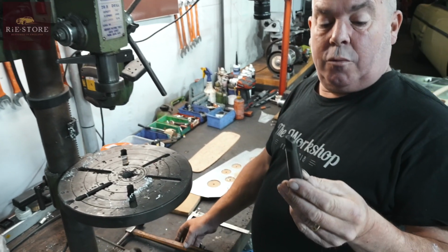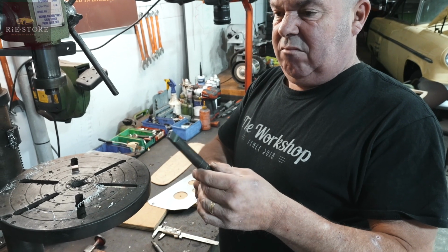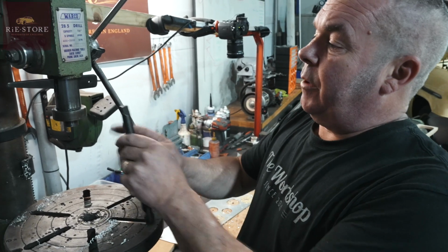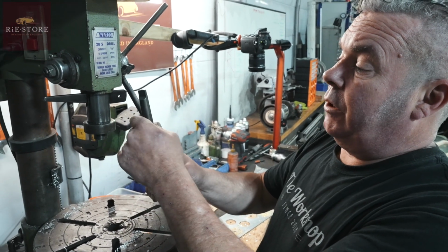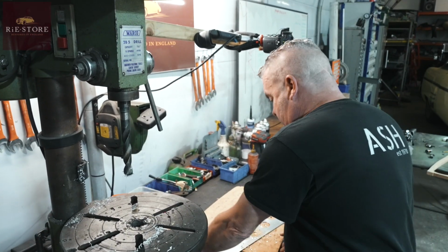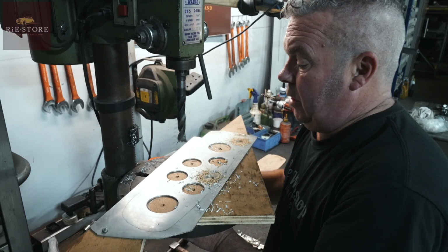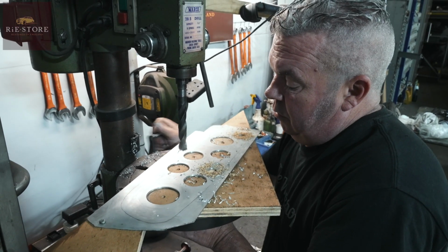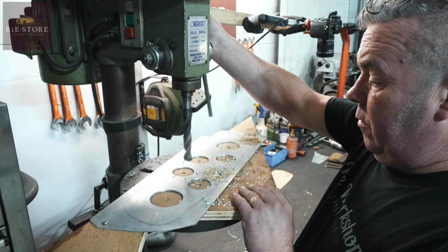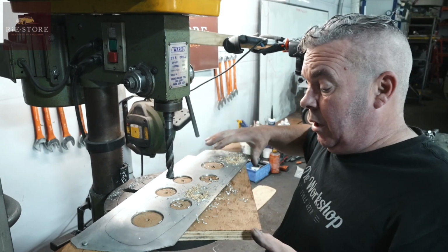They're called Morse taper drill bits. All come in different sizes. MT1 up to, I can't remember. That goes up inside where that bar is. It stops it rotating as such and just locks on the taper. What you want to do is put him in there. Get a piece of wood. Wind him back up so I can reach it. Just give that a little tap on a blank bit of wood, and that taper just holds it in. Oh, okay, yeah.